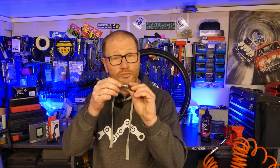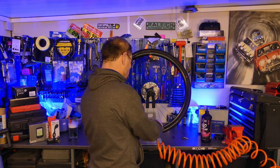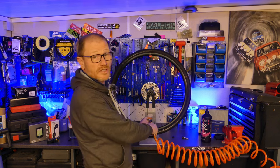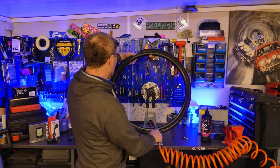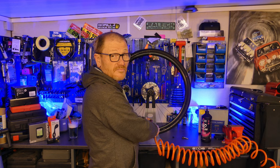The next thing we're going to look at are your valves. Sealant gets everywhere and blocks absolutely everything up — but let's face it, that's what it's designed to do. The trouble is that plays havoc with your valves, and the regular topping up of the air means the valves are also seeing a lot more traffic. Those delicate little rubber seals inside the valve cores get bunged up with sealant and then, yes, they leak. Let's first get some air in that tire. Interesting — did you hear that valve struggle to let air through? That valve is sticky.